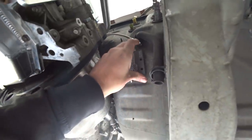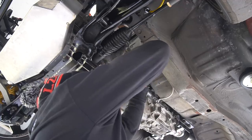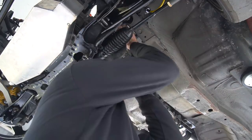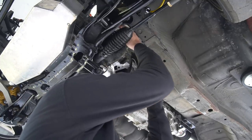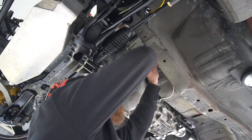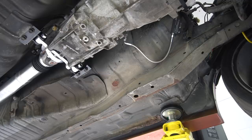So we've got our line coming from the clutch master there. That'll go into this thing here. We'll mount it about there, and then luckily this fitting was the exact same thread as the Nissan one, so that got real easy. I got it right. So we'll get this mounted up and then tie it all together. You have to mount it a little crooked for the best line routing. Yeah. All right. Delay valve bolted up.